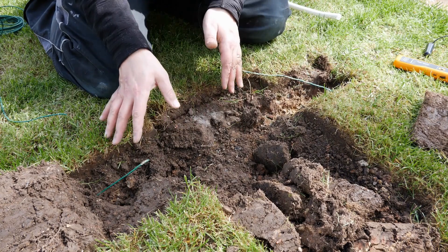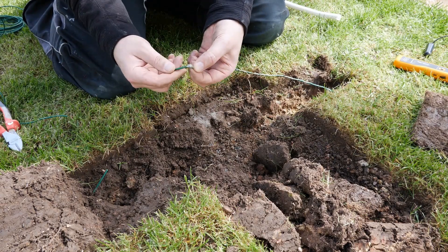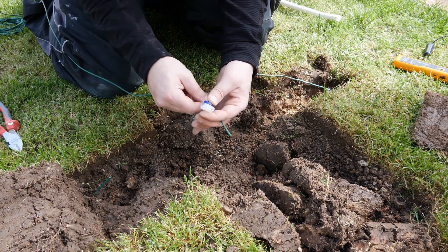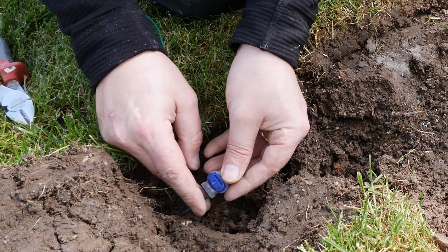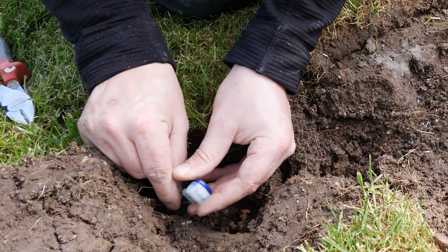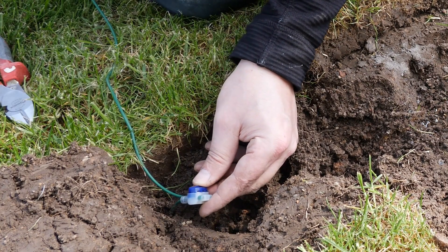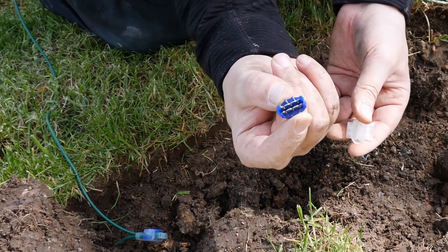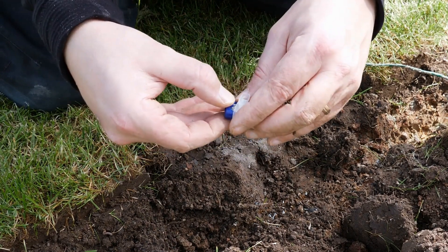For the repair, I have exposed the cable up to the points where it is still in good condition. At the intact point, I will cut it — the other side still has damage so I will not use that part anymore. Next to these 3M cable connectors, which I have linked under the video, you can also use cable repair shrink tubing. However, I find these cable connectors very practical and easy to use. I simply plug the intact cable in all the way, ensuring it is completely and securely connected. I also insert the replacement cable all the way in. Then I carefully press down the adapter with the pliers, ensuring a secure fit.